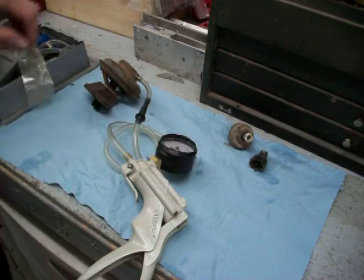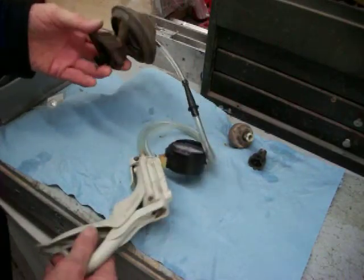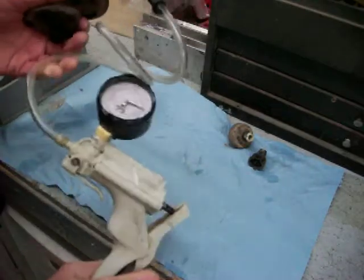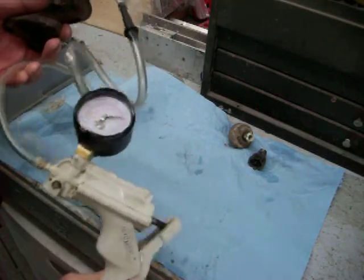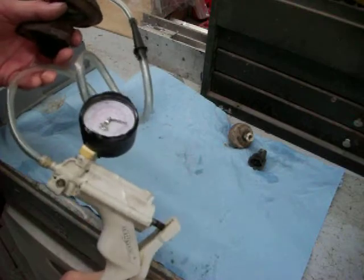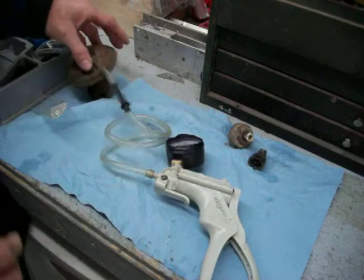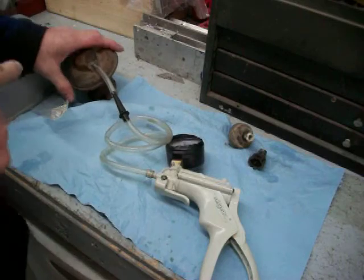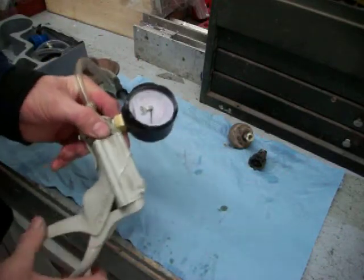So I'll go over this with you first. This is an EGR valve off of that truck. Now when you put vacuum onto this thing — this is a vacuum pump — it should hold that vacuum in there. And obviously it's not holding anything. So I replaced that valve. I haven't had a chance to drive the truck on the open road yet. One way of testing these EGR valves is to see if it'll at least hold some vacuum. This one is holding nothing.